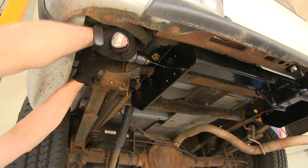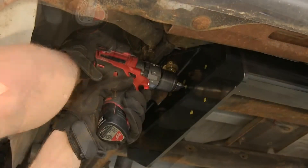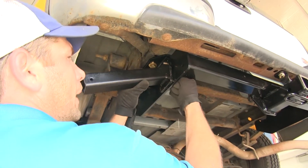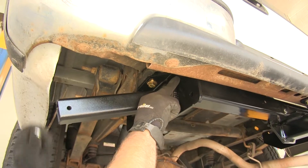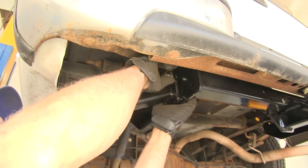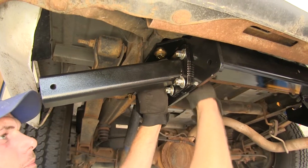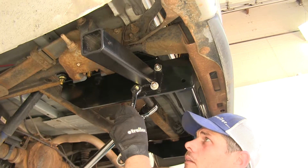We're going to start with a smaller drill bit to get our pilot holes drilled. With all four holes drilled out, we take our frame bracket and pass a bolt through — it doesn't really matter if we go from inside to outside or outside to inside. Put on a flat washer, a lock washer, and then one of our nuts. Repeat that process for the other three hole locations. Looking at the instructions, we'll find our torque specifications and torque down each of our bolts accordingly.